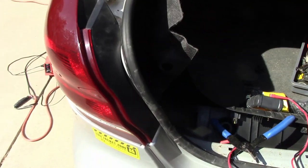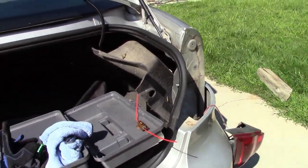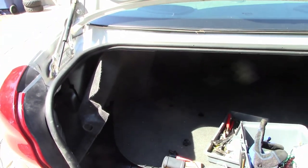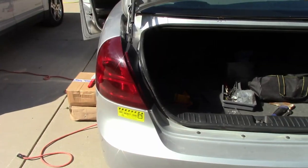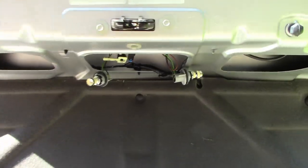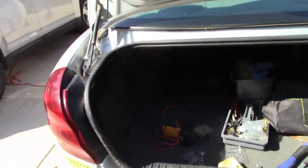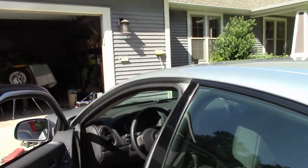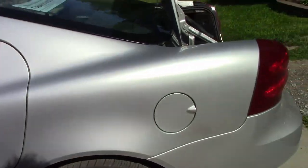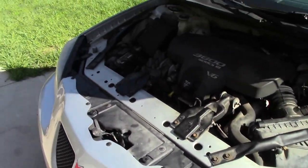There it is in its final mounting position and you can't even tell it's there — I call that a success. Now we just need to do the other side, then replace the front amber ones and this thing's all set for turn signals. I got both taillights back in, both have resistors on them. I also went ahead and replaced the reverse lights with LEDs as well — those are very easy to get to. I can test these by pressing the unlock button and covering the day-night sensor to make it think it's night time — there they come on.